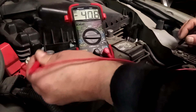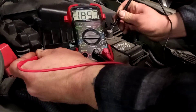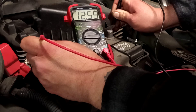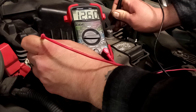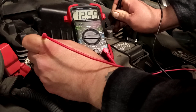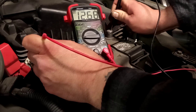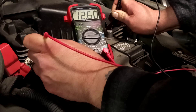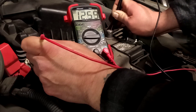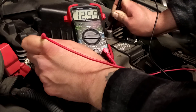You're going to disconnect your battery and take your positive lead for your multimeter, set it to 12 volts, stick it on the positive side, and take the negative and stick it on the negative side. This battery standalone is coming in at 12.5, 12.6 volts, so we're in good shape. I've let this battery sit disconnected for about 20-30 minutes to ensure it wasn't showing the alternator's charge. If you're at 12.3, 12, or 11.9 or anything like that, we might want to change the battery. But this battery seems to be testing just fine.